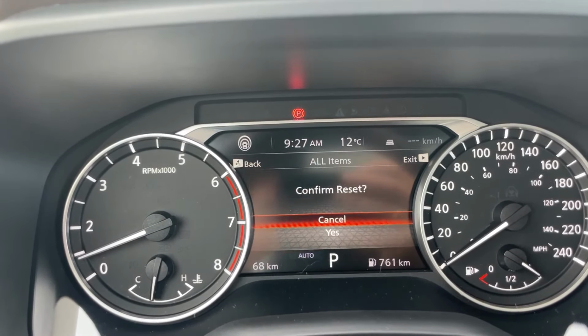From there, you're going to want to go to a service station or a gas station, somewhere that's got an air pump. Leave your Rogue running, grab the hose and go to the tire it says needs air and start putting air in. And when you get up to the correct pressure, the horn will beep once to tell you to stop. If for some reason you continue to put air in or went to the wrong tire, there is an upper limit that when it hits it, the horn will beep 3 times in a row.